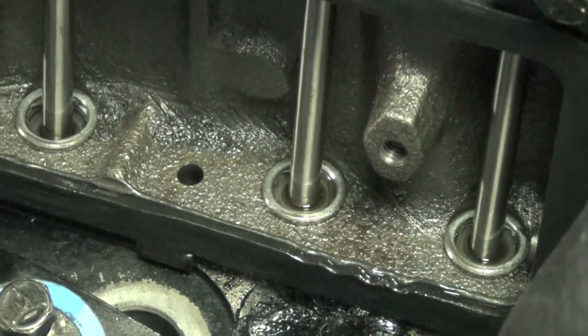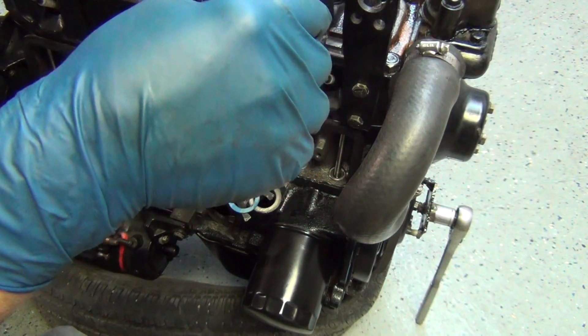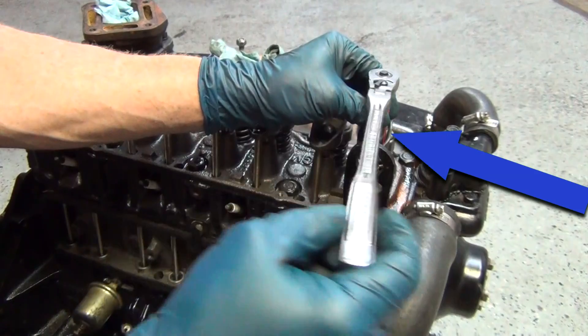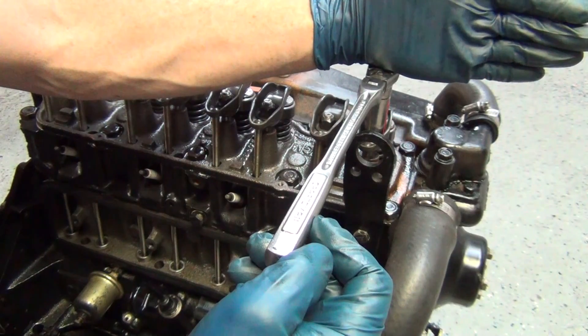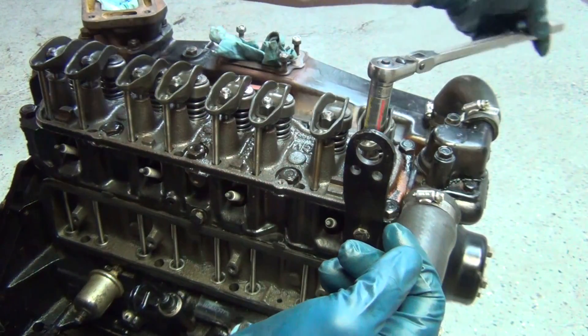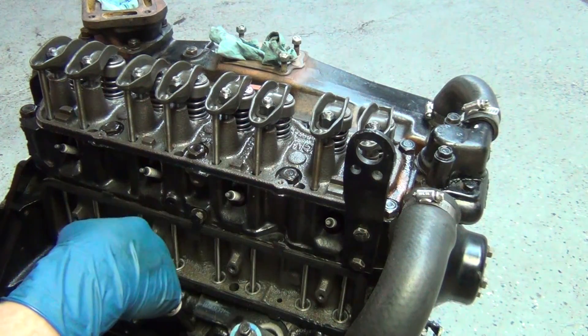So what I do — I'll zoom the camera back out so you can see what I'm doing with the wrench. As soon as it zeroes out to where it doesn't have any up-and-down rattle or play, this is where my fancy little lines come into play. I have the ratchet squared up here, and I want to come all the way around to 90 degrees the other way — through 90, through 180, to 270 degrees, and then a little. According to the guy who taught me — who has been doing this for years and years. Thanks, Roger.